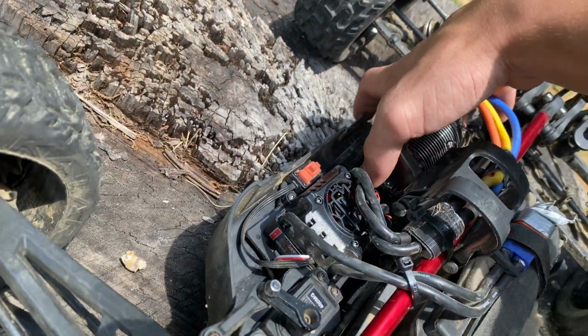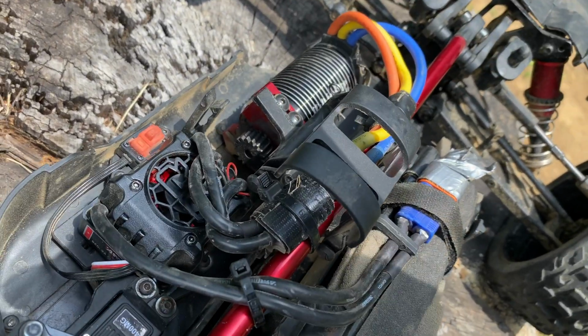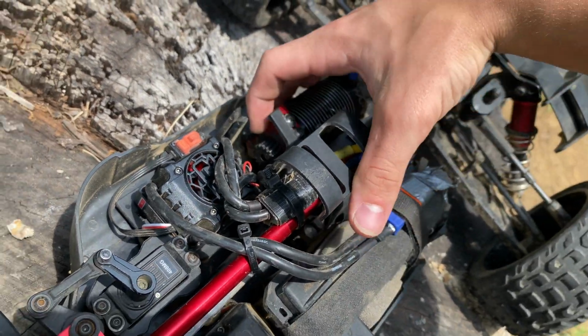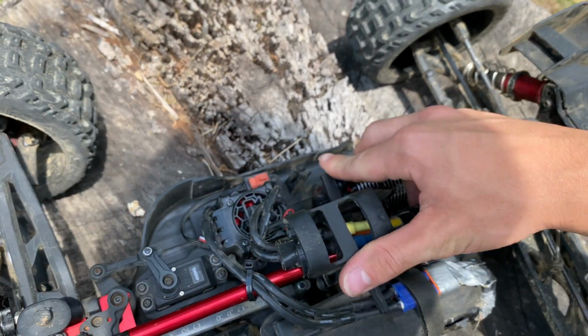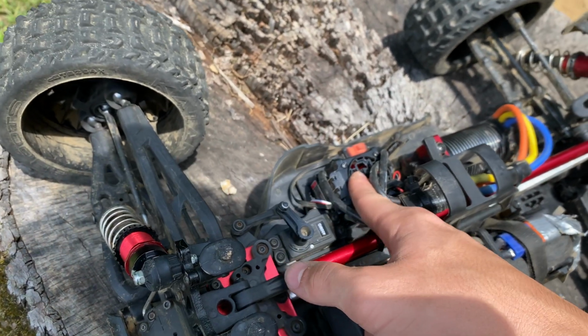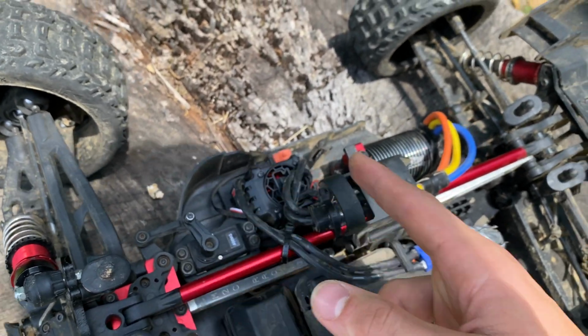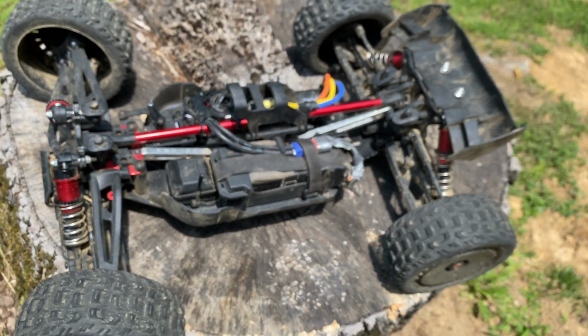But the pinion is pretty big. It's a 17-tooth Arrma Safe D pinion, and it's pretty good actually. It's never come off, never even rounded the grub screw loose, and it's really, really good. The motor does come with 6.5mm bullet connectors, so if you're gonna run a stock ESC on 6S, you're gonna have to change those over on the ESC to 6.5mm bullet connectors as well.